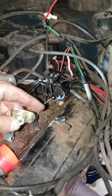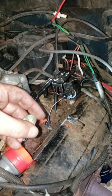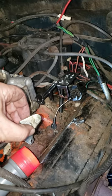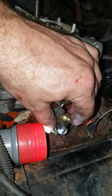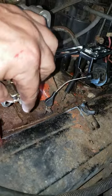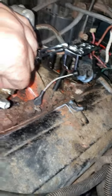One thing I haven't mentioned yet on this video is I did order this part, which I actually tried in an attempt to make the stock stuff work. But this is a throttle valve cable corrector. It actually has an Edelbrock part number — I'll see if I can find it and put it in the description. It goes on there like so. It bolts onto that and then your TV cable goes on there. I think with the distance that it moves, it should be pretty close to being right. We'll find out in a minute.